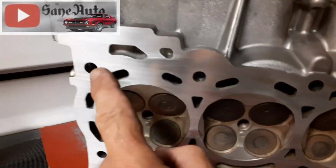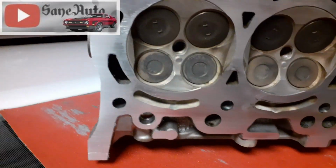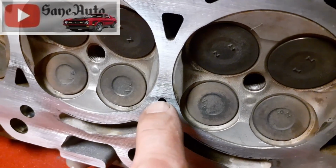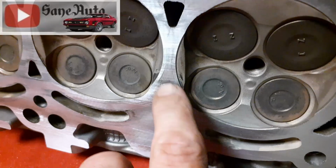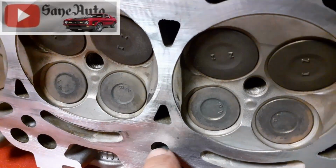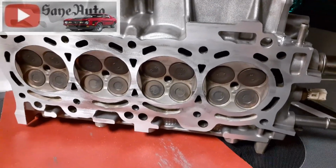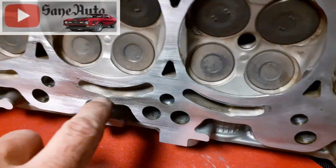If you look right here, around this cylinder just looks so fantastic after going over it a little bit more. And this one looks pretty darn good too. But you can start seeing a little bit of a low spot right there where my fingernail is. But the biggest low spot is right around here, mostly right in here, and a little bit right there. But this area right here, when you back away, you can see that. So that's one of the things that flat sanding does for you. It really shows up those low spots. And there's a little bit right across here.